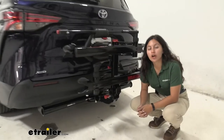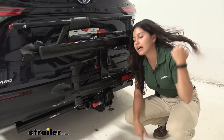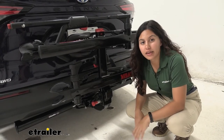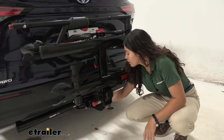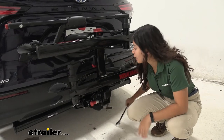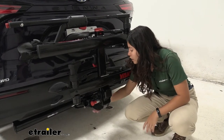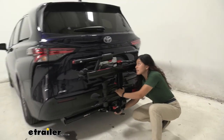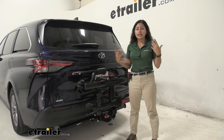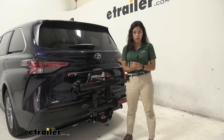Down at the shank, this has a 2-inch solid shank and comes with an anti-rattle bolt and a lock that is keyed the same as the lock on the arms — so you only need one key to access the whole system, which is something Yakima does really well. It comes with a tool to tighten things down, but I highly recommend a ratchet wrench — I used a 24mm, though a 15/16 socket works too. Tightened down, when I shake the bike rack I'm essentially shaking the vehicle, showing it's a very tight fit with no rattle from the rack itself.